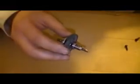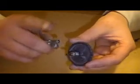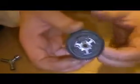So first we got to start by pulling off this end right here that goes into your drive shaft. Just loosen that screw up and that pops right off. Set that off to the side. We're going to slide this bearing out of the way, and then loosen this nut up here. Pull this stuff out. And then you can pull the spur gear with the slipper clutch pads attached to them right out.